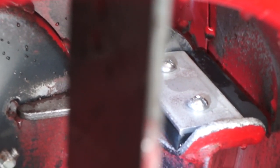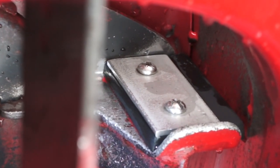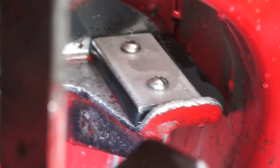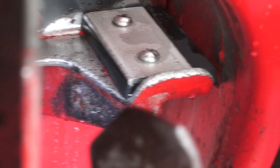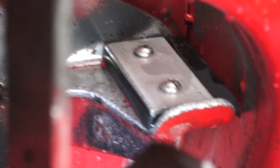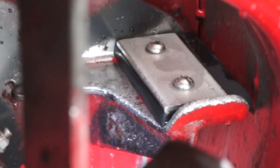But anyway, so you don't necessarily have to do this impeller modification on a Honda, but it's kind of cool to have that little tiny bit extra, so that you can throw all the slush and snow into your neighbor's yard and make sure you reach the side of his house with it. Just kidding. But this modification adds a pound to the impeller, so you've got a greater moment of inertia there, so it would probably have a little more torque to carry through that deep stuff that you run into.